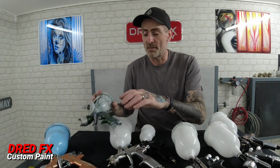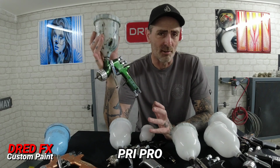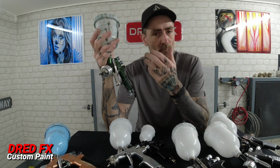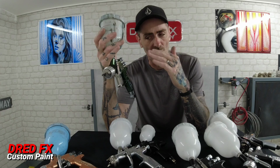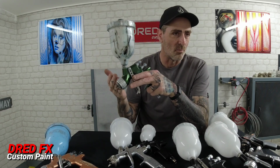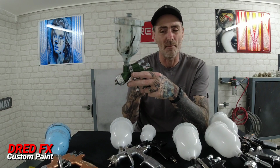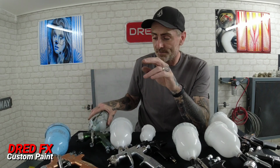We've got next up is the PRI Pro. Now, PRI Pro's been around for quite some time. It's a heavier gun than the FLG 5, better build quality than the FLG 5, and the price range comes up slightly. You can get this in a 1.3, 1.4, 1.8 and 2mm setup, so it'd be good for applications of primer and base. So a good gun to look out for is the PRI Pro.